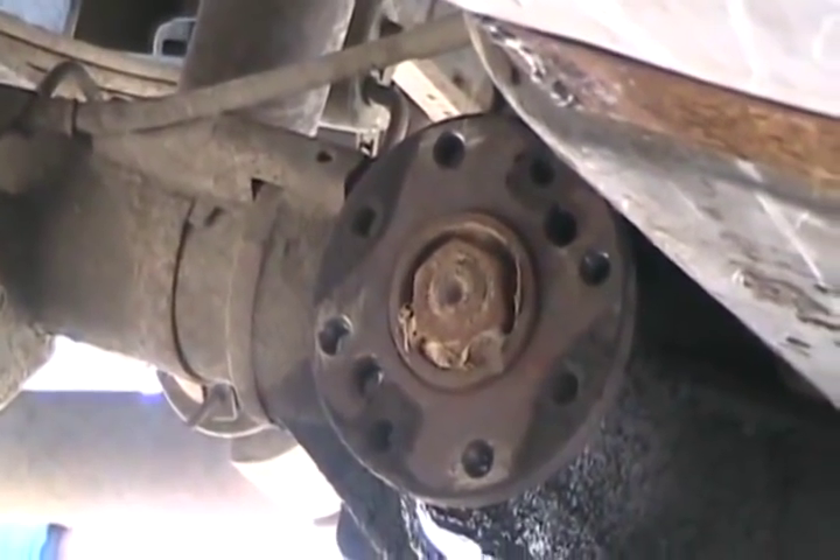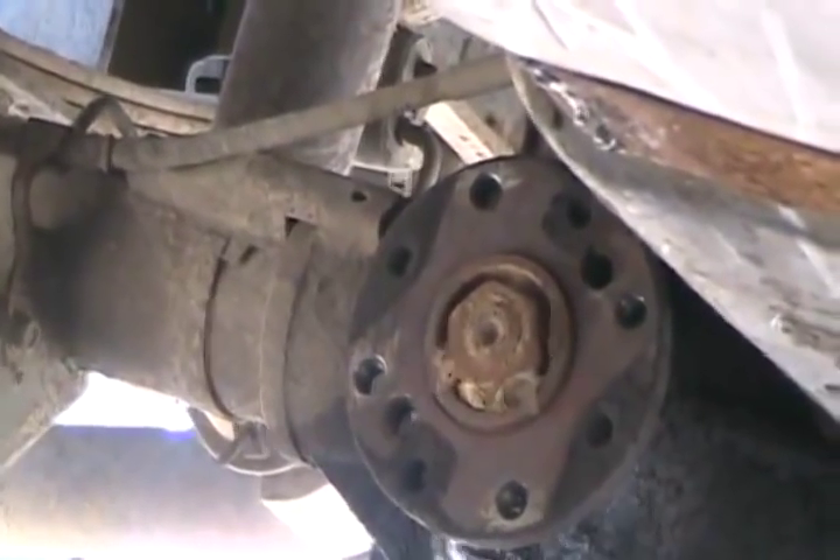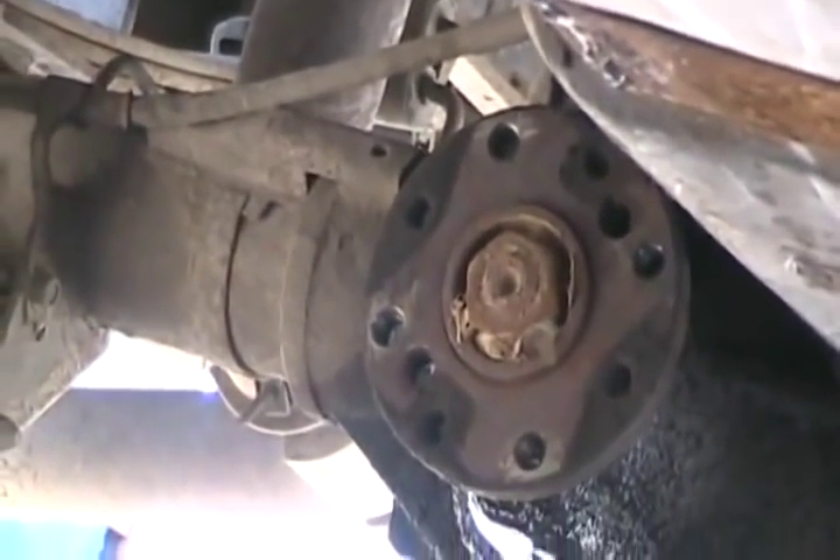I took a look at the truck in the forest — the drive shaft is exactly the same length and it fits this tranny. The drive shaft that came off this truck won't even slide into the back of the tranny. The only difference is the mounting at the rear: on this truck it's got a plate with four holes, while the truck in the forest just has those two U-shaped things that you strap your U-joints down with. So maybe I can just switch drive plates or take apart the back of the drive shaft on the other one.